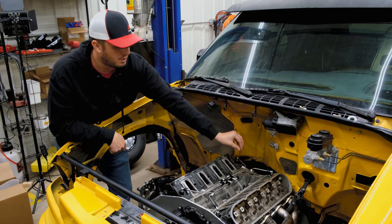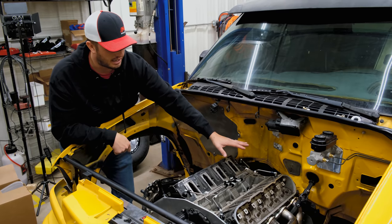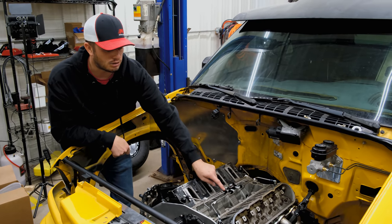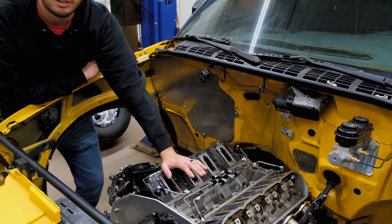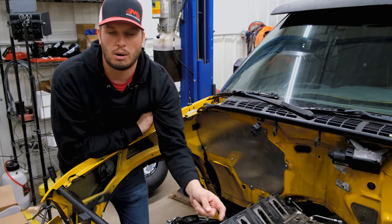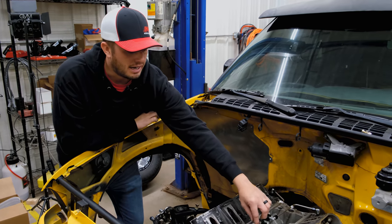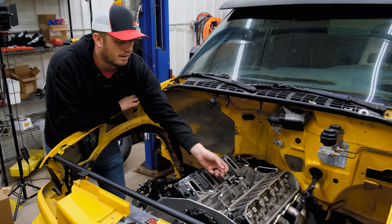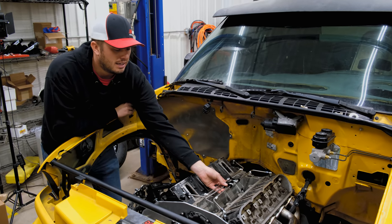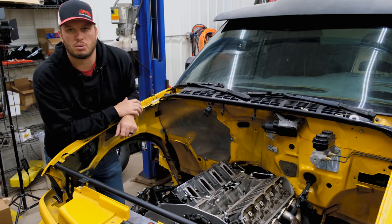At this point, fluid and steam and hot air — everything is running through all of these lines out to a common port. On this stainless kit we have a barbed fitting so you can hook up a rubber hose to a stock style intake, and there's a 4AN connection underneath there. That gives you different abilities to hook up to a radiator.